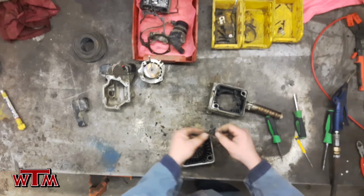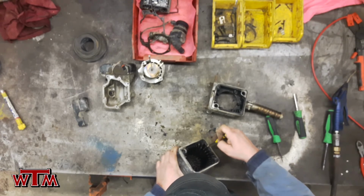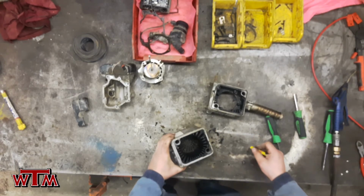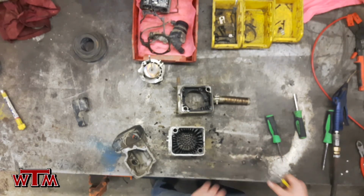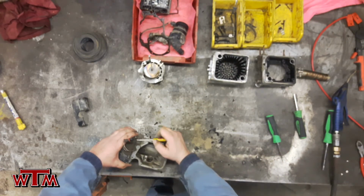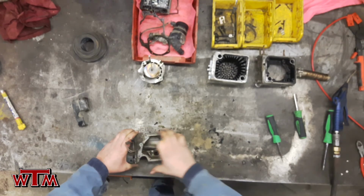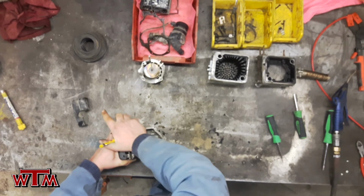And you can't see it much in the shot, but when I'm taking this apart, I'm going to point it out here, you can see exactly the wet, gummy carbon there. That's going to be a telltale sign for me that it was either the top one on that one or even the bottom one, I guess, could have started flooding it, but the coolant got in there, and that's why it's gummy. If the coolant wasn't bypassing right around those O-rings, and it was coming through the heat exchanger, I don't think I would have seen the gummy in the carbon buildup there. It would have been a lot harder and rock hard, like what came out of the inside of the combustion chamber.